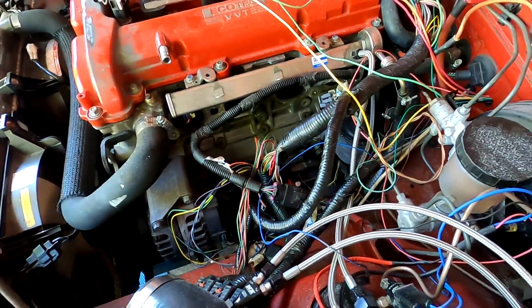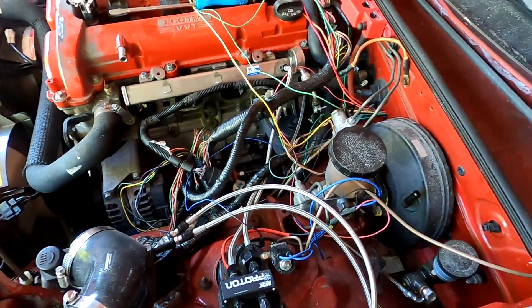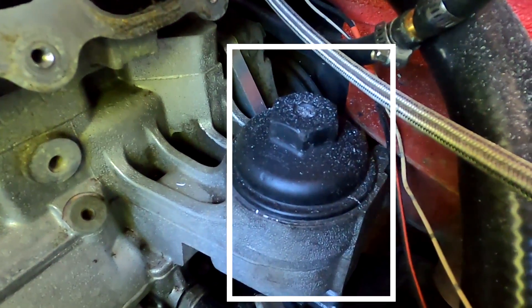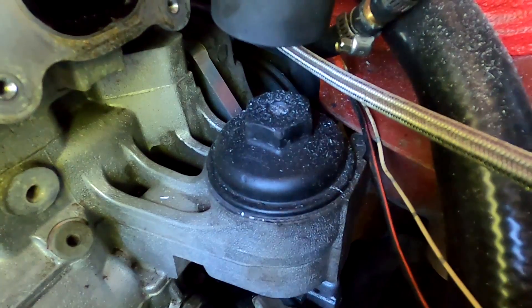This is kind of janky to do. A lot of lines, especially the nitrous lines, made it a little bit more difficult, but it only took about 10 minutes to get to this point. With the intake manifold removed, you can see there is our oil filter housing. That black plastic cap on it needs to come out so we can actually access the filter and remove it.